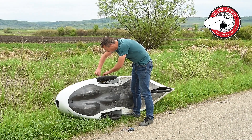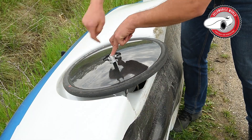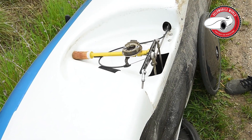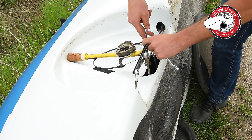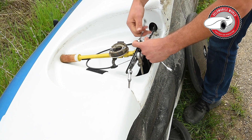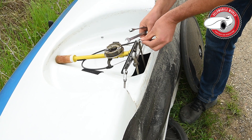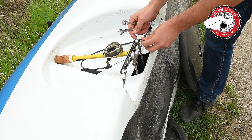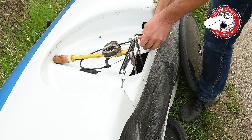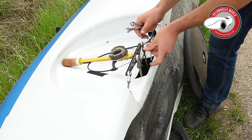The easiest approach is to take down the wheel because you can get to the adjustment spot very easily. So I take down this one, and when you put it back on, put some Loctite 243 on it to make sure it's 100% secured. Although it already has a fillet on both sides so you have a counter force, I still prefer to also have Loctite on it.